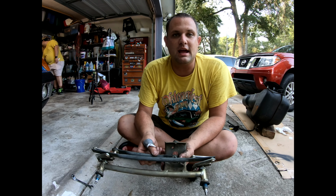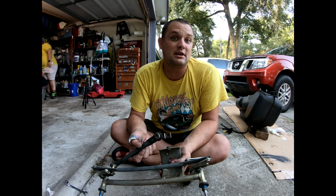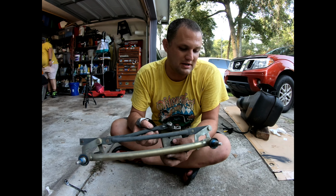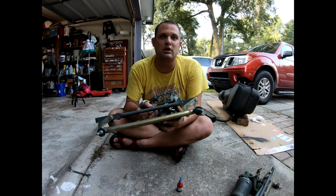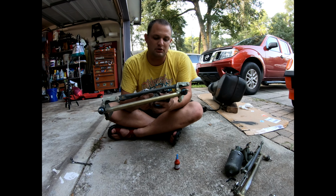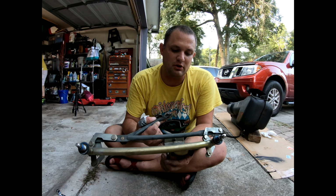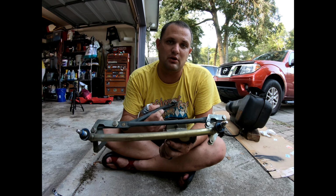So we went ahead and tested out the old motor out of this mechanism, unbound up, and it does work as well. So we're gonna put them both back together with some Loctite, so we'll have a good working spare for anybody's 914 that needs it locally or whatever, and we'll determine which one is the better one to use, and we'll pop it back in the car. So a lot of work to replace 3 bolts, but wipers are necessary, and we know that this will do it.